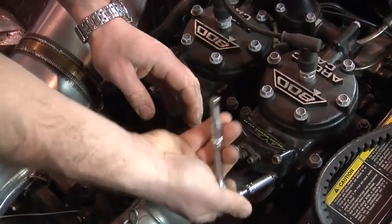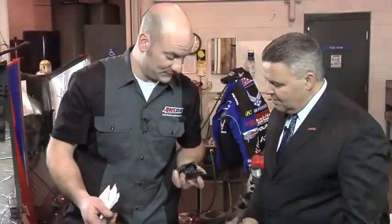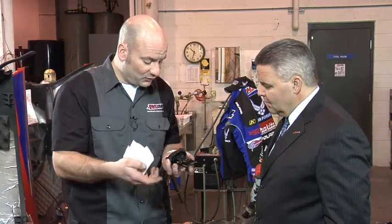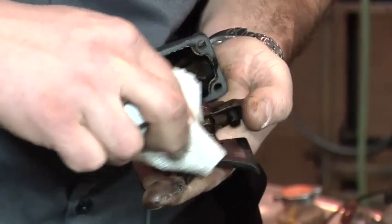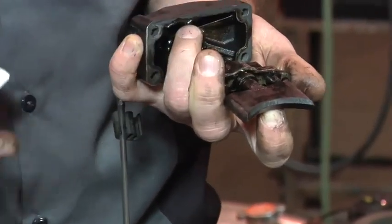So can we take one of these off and take a look at one of them? We sure can. So Len, what am I looking at? Is this good, bad, indifferent? Well, if you take a look at this valve, we're looking for depositing, looking for carbon. This little bit of oil that you're seeing around here on the edges — that's normal, they're all going to do that, you want to see this. If you pulled it out and saw all kinds of hard carbon on it, you'd know right away. What we can do is wipe away this little bit of oil that's left over, and what you can see is that there's virtually no depositing on this valve at all. It's very clean — this is a real good example. So if you have a clean valve, that means you're going to have a good day on the trails. This valve will operate freely. This one didn't really need to be cleaned.